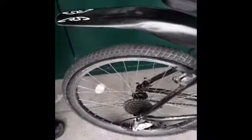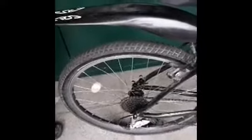Okay. So again, all the noises are different, guys. I know it might be difficult for you to hear on the video. So, just changing into the second one up now, it's getting a wee bit of a push to get it in. The third one was smoother that time. Okay, so again, we're on the right track. It's a case of adjust, check. And don't be tempted to go too far, do it small bits at a time. Because if you go too far, you could knock it way off and then you're right back even worse than you were when you started.